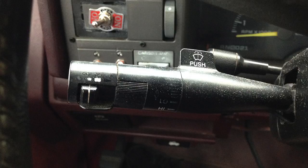Here's a close-up of the switch that's in there now. I'm going to leave the switch in because it also handles turn signal duty as well as the dimmer for the headlights. It's two separate circuits, so you can disconnect the wiper circuit down at the base of the steering column underneath the dash and still keep the turn signal switch and headlights switch working.